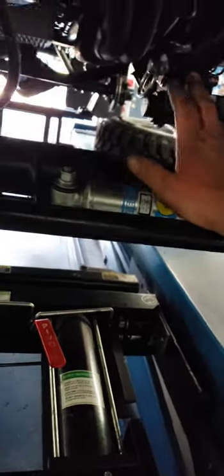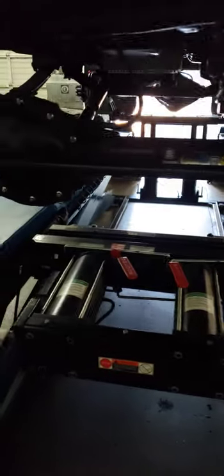Number two: if you have a lift on your Blazer, these little doodads right here — it's a sway bar correction kit from Off-Road Design. It makes a huge difference. What happens is, when you hit bumps and you still have the stock sway bar mounted up after putting a lift on the truck, you have this big separation and have to put in spacers or blocks. When you hit bumps, it actually pulls or pushes the axle, and when you have a drag link setup, you get roll steer — meaning when you hit bumps going down the road, it wants to jerk your wheel left or right.